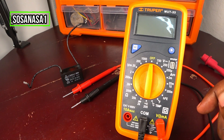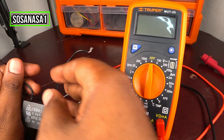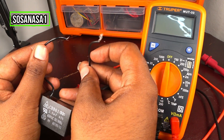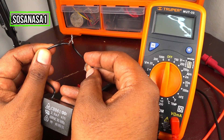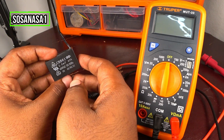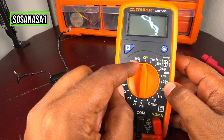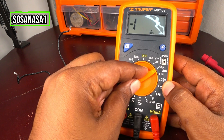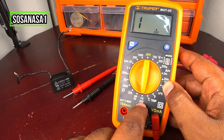This is very easy. The first step is to take the capacitor and discharge it in this way. Touch this cable with this in this way. Now this capacitor has no energy. Take the digital multimeter and using this selector, move it and put it here in continuity test.